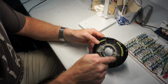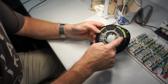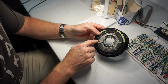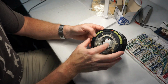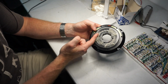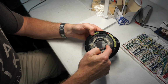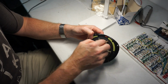I wrap the ribbon cable around the center part, and then after it's around the center part, it came around one of these rubber band things and went to the connector. And one of the cables was longer than the other, so it came and went around this one into the connector. And this one's just holding them all in tight. So that way, as you turn it, this one's rolling this in tight against the outside, this one's rolling this one in tight against the outside. This one's just keeping any that are on the outside, and keeping the ones that are on the inside nice and neat, see? And it seems to work perfectly.